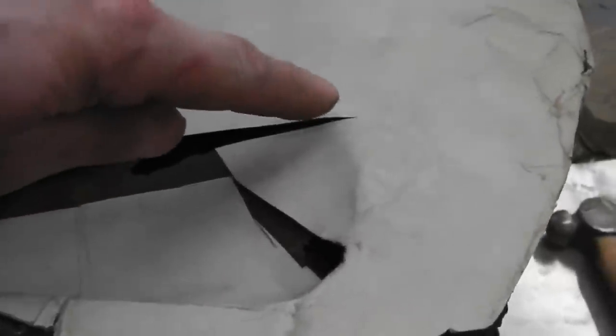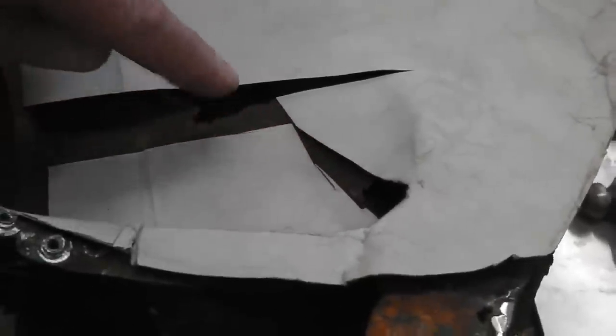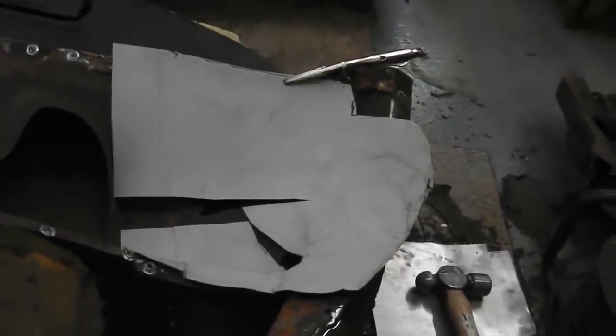and there's some slits, so really we need to make it so that we overcut it, then put the slits in them. By the time we push it in, there'll still be metal in that. If I don't do that bit right, then I'll put a fillet in there to fill the gap. That isn't too bad. It would look neater without them, but we may have to just put fillets in. Let's see how it works. It's not the end of the world if we have to put fillets in.